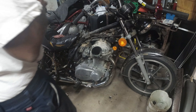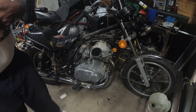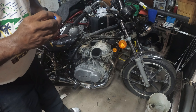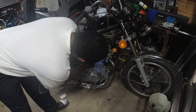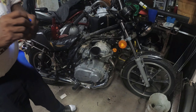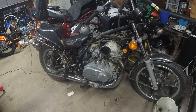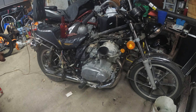What's up my people! Alright guys and girls, I've been taking a few things off — got the shield off, got the gas tank off, taking off this sissy bar. I don't know when it was last started. Looking inside with a flashlight — yeah, I can see rust in there. So it could be weather-seized, so I'm putting Marvel Mystery Oil in the top end cylinders.